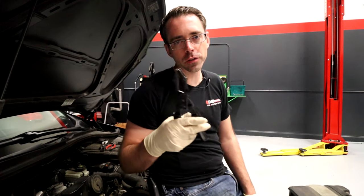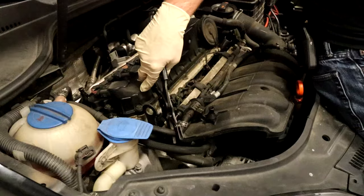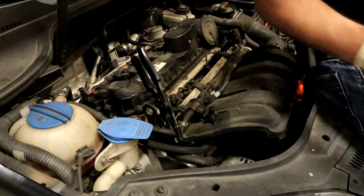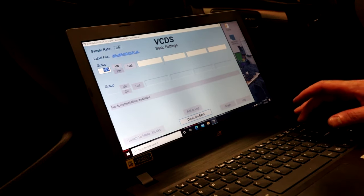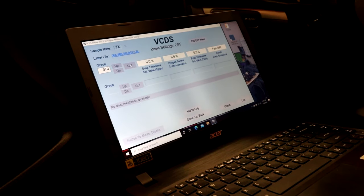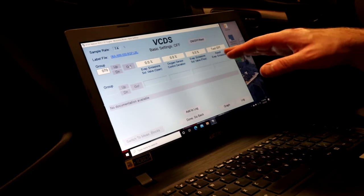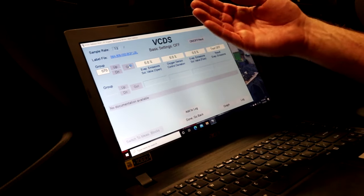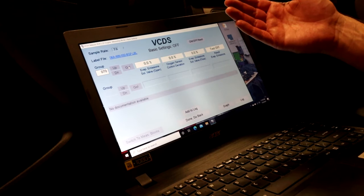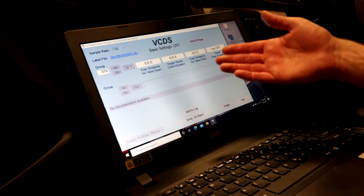The last test uses pinch-off pliers to pinch the hose going to the valve. We go into the car with VCDS and go to basic settings. The car needs to be warm, and we go to channel 70, which is the evaporative emissions control test. Once this test runs it will test whether the evap system is good. If you've just replaced a valve and want to verify it, this will almost certainly determine whether your evap system passes or fails.